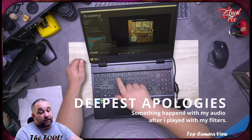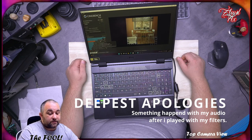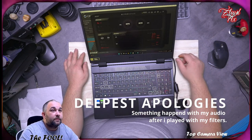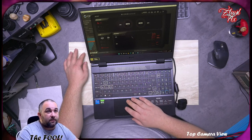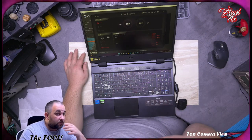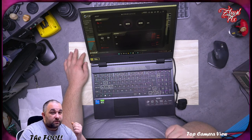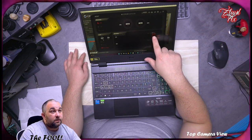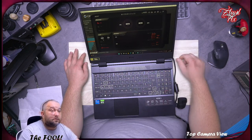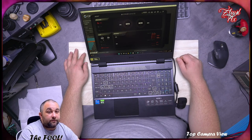It doesn't look very good. It's 12,074 points, and it boosts only, it says, 3.11 gigahertz. So let's see NitroSense. And NitroSense is saying that it boosts to 3.245. I could install a hardware monitor to have a closer look, but it doesn't look like it boosts where it's supposed to, and that is because it's throttling. It goes down only in between the scenes in Cinebench. So I'm not happy with this one bit, as it's supposed to go to 4.5 gigahertz.